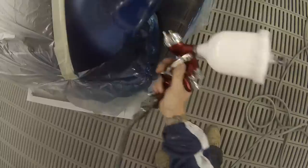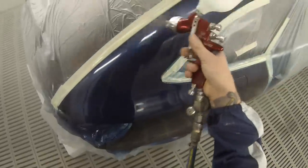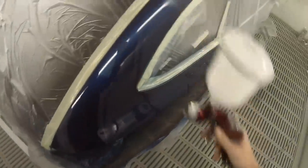They don't have the digital gauge on them which some of the Sata Jets have, but I find that's just a bit of a gimmick really, because you don't really need them. I've got gauges on my guns and I don't even use them. I just judge my air pressure by ear. You can hear the pressure — you look at it when the gauges are new, and by the time the gauge has got a bit of paint all over it, you don't even need to look at it anymore. You can hear the right amount of pressure.